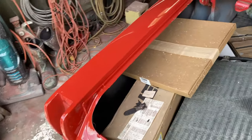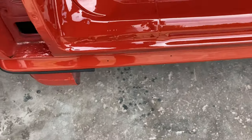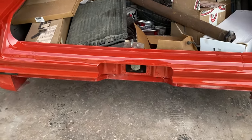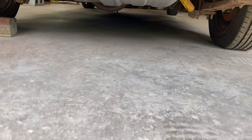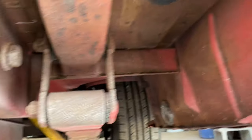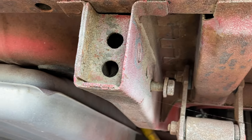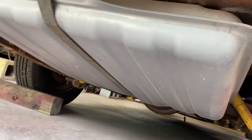Currently in the back it's missing the trunk rubber — I got all that old stuff off, scraped it down, cleaned it down, primed it, all that. I can go ahead and do the tail lights and our trick little panel that goes there — I saved it. I could do the back bumper, but currently the gas tank's going to come out. I got to clean it out really well. The rear end is going to come out and I'm going to do a coating under the car. I can see my white overspray there — I'm going to coat under the car with rust encapsulator.